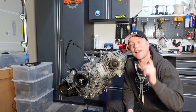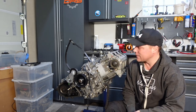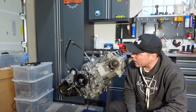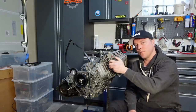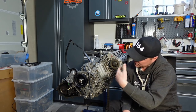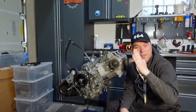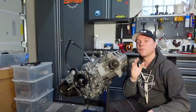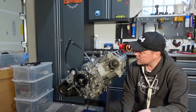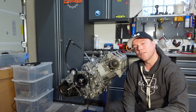So this episode starts off where the last episode left off. This engine now is complete in the sense that I have the cylinder heads on both sides installed, the cam towers installed on both sides, everything is torqued down, ready to rock. I've installed the cams to see that they move nicely and actually installed the rockers as well, but I'll likely have to remove those now.